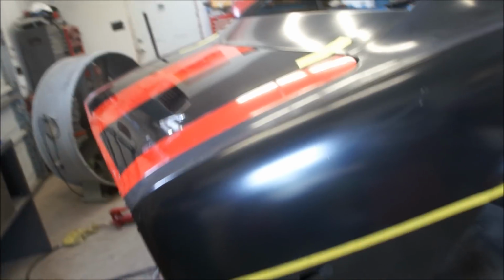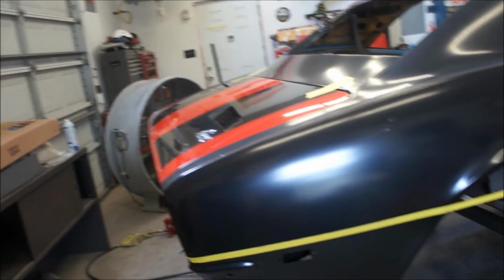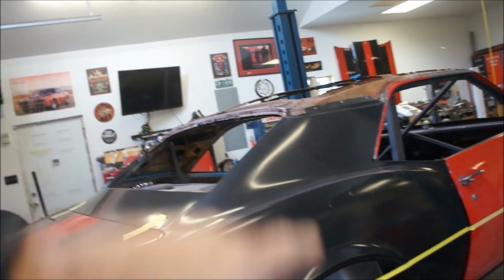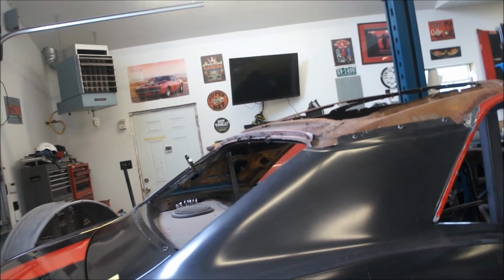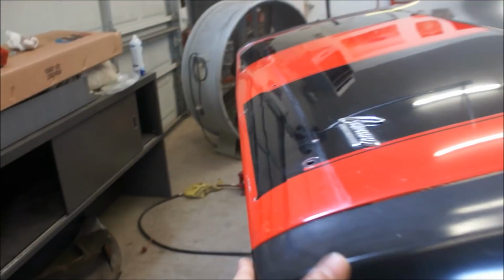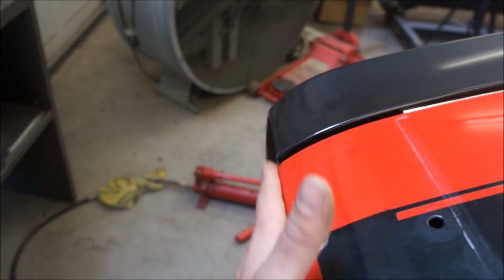I've got to get the other inner trunk drop-off inside here, get it lined up so I can pin both of those. Then I'm going to blow all this back apart and weld up this thing here, weld that in, and maybe cut the rest of that stuff off and get my new roof skin and drop it on, just to get an idea how it's going to fit up. But yeah, it's coming together. It's looking really good. Very, very happy with it. Everything looks good, fits nice.